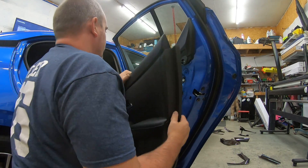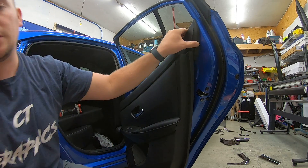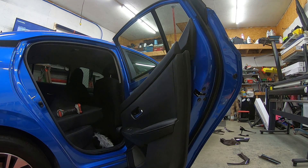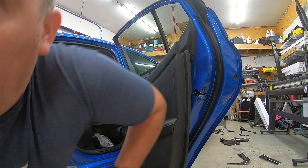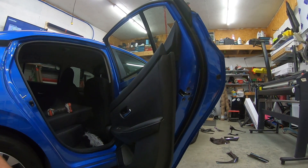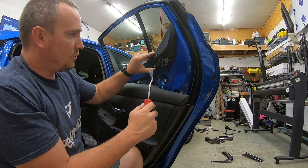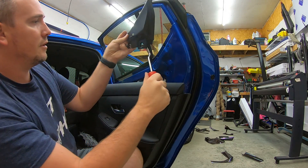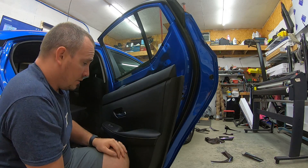No speaker in this one. If you need to take off this trim piece up here, you're going to use a pry tool for that. There are two white clips here — you're just going to go up underneath them and pop them out. There is a third clip right there that does pull out once you get the bottom two out. You need to get that off, and that's how you do it.